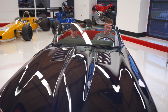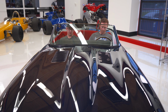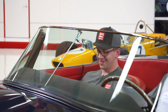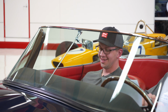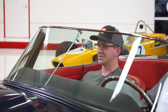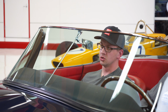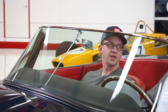Yeah, for sure. Christopher Bruce asks, what towel do you recommend with Ceramic Speed Shine? I recently did my wife's Macan with the gray edgeless towels and covered the paint with toweling marks. Porsche Black, shake my head. Yes, shake my head at Porsche Black too. It is incredibly soft and finicky. Those gray edgeless towels won't put towel marks in the vast majority of paint systems, but Porsche Black is one that almost any microfiber will put towel marks in. However, our plush edgeless, the blue edgeless towels, the high nap towels, are going to be your go-to for extremely delicate paints like Porsche Black.